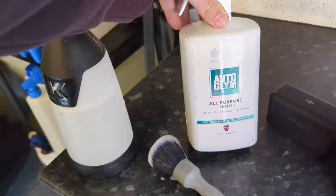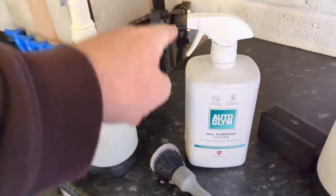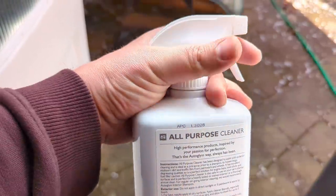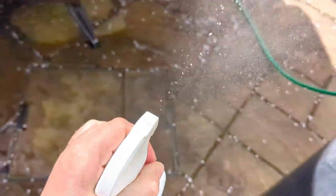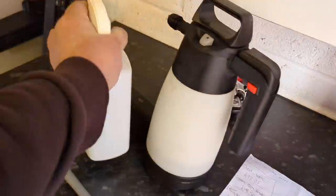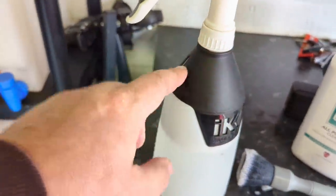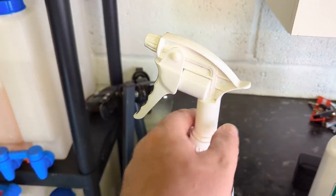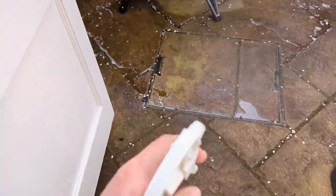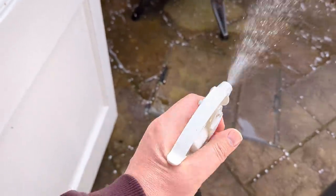When you use it as a pre-wash you will get through tons of it — if you're going around spraying the lower panels, you fly through it. The trigger on the bottle hampers your grip a little due to the square shoulders, and outside in the wind it can be difficult. So I like to decant into IK sprayers with a Toco Big Blaster nozzle — it has a 4mm chamber and just hurls chemical out. You can go through product a bit quicker, but it saves your hands.